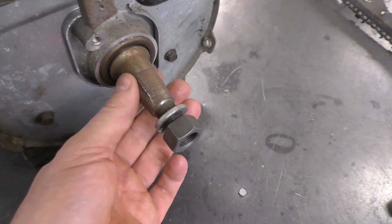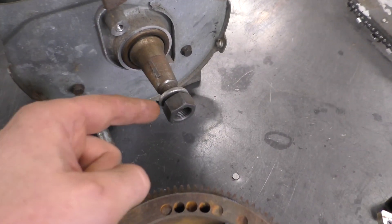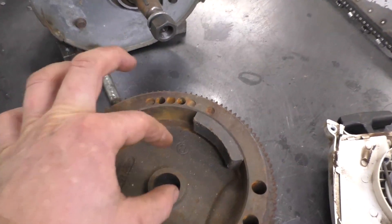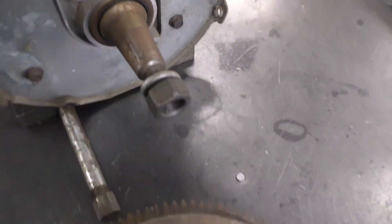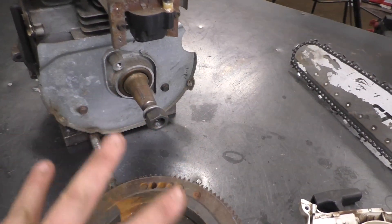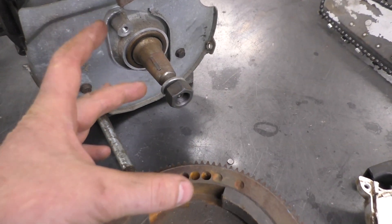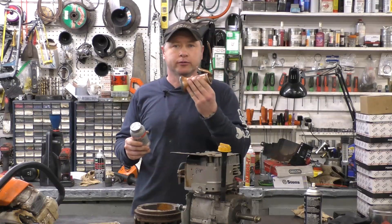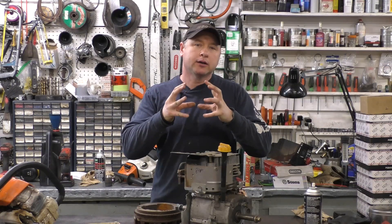The reason you don't want to do that is because the flywheel crankshaft is tapered. When you install the flywheel on the tapered shaft and torque the flywheel nut properly, this is all meant to create a lock — it basically locks the flywheel to the crankshaft. Your flywheel key is basically just meant to align the flywheel so that your ignition timing is not off, but the whole purpose of the taper and proper tension is to create that lock. If you put anti-seize, oil, or grease on the crankshaft, you're preventing the flywheel from making a proper lock.